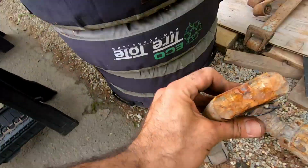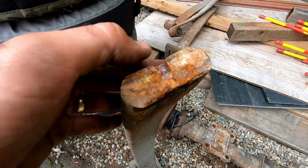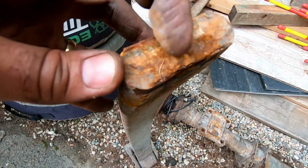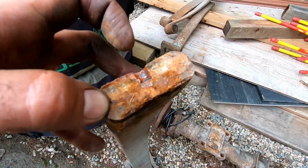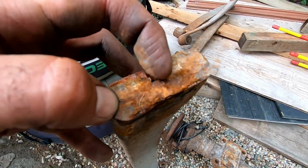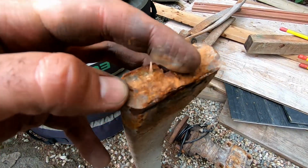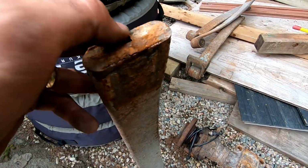And to be honest, I kind of just wanted to show you the actual design of the spring, because to me this is not the best thing. The centering pin fits right there, and as I can tell, it's basically sheared right where the centering pin fits. So as far as I can tell, where that pin sits, you're gonna have water and salt kind of coming through, and as you can tell, it's basically just cracked in and corroded. It's not a very good design.